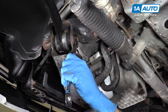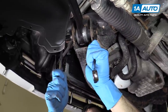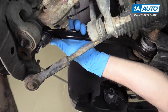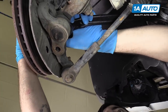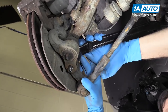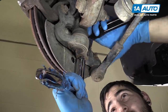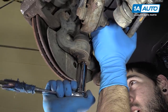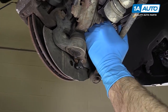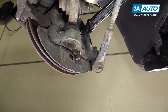We'll support the nut with our 21-millimeter wrench. We're just going to get this down close but not tight until the weight of the suspension is on the vehicle — otherwise we risk preloading the bushing and causing premature wear to our new part. Now set the ball joint end into its hole in the control arm. You may have to move the stud in the ball socket, or turn the spindle one way or the other, or pull it in and out to align everything properly. Start your new nut on the end of the threads. Push down on the ball joint to set the taper into the spindle — this should help prevent the stud from rotating. If not, we'll have to use that 6-millimeter Allen key to hold the stud in place while we tighten the nut with a 22-millimeter open-ended wrench.